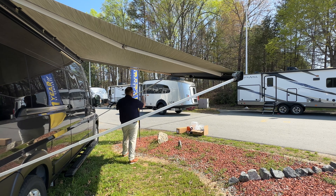One other thing you're going to see with the ProMaster is there's no connection points on the side — it's clean, it's sleek. Everything is either below where you see the smart plug or the exhaust pipes, or it's integrated behind this door. Now this door was in my 'five things I disliked about the Range Line' video — I'll link a card above. Behind this door you do have a light so you can hook up at night, your black tank flush, your city fill which does have a pressure regulator built in. I said in past videos to put an external pressure regulator in front — don't do that. I was wrong; just use the built-in pressure regulator. And then you've got an outside shower right here.